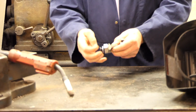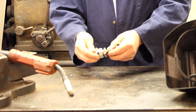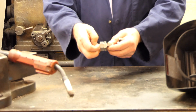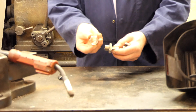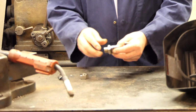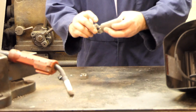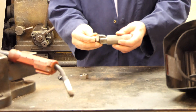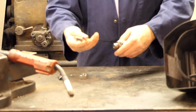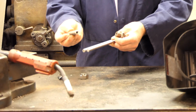This is just made up out of a bolt, stainless steel bolt. So it's all going to be stainless steel. So that's to screw onto the plate. I've turned the nut out there, and that'll give me the pivot. I welded a plate on there with a hole in, so it'll drop in like that, and then it will latch down on that. I've cut two stainless steel bars and I made a foot peg lever.